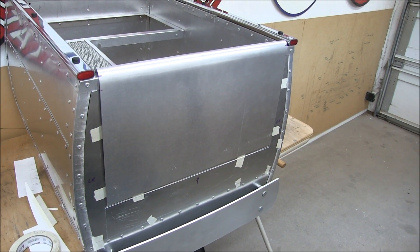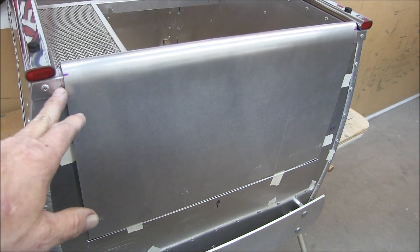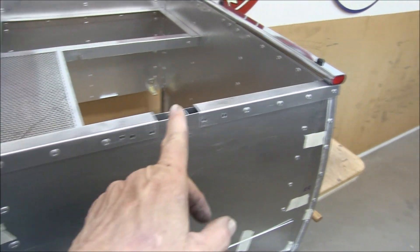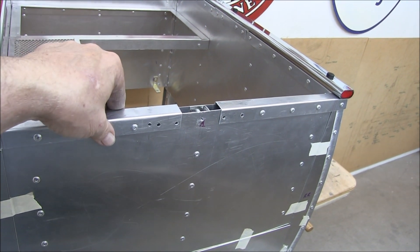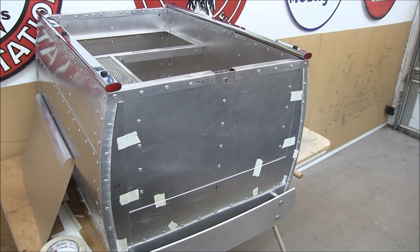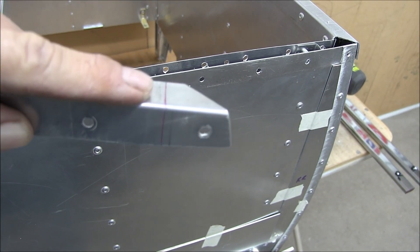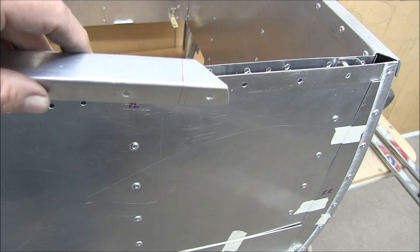It's interesting that I really didn't have everything figured out on this tailgate when I started working on it. Now that I'm at this point I've decided I'm going to remove this top strip. I'm going to drill out these rivets, cut it here and here, leave a little bit on the ends, but take out this middle. That will allow this panel to fit down much better over this. They're drilled out and I'm going to cut it right on the red line — that will touch the tailgate portion so there won't be any gap.